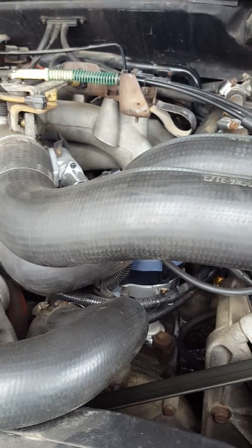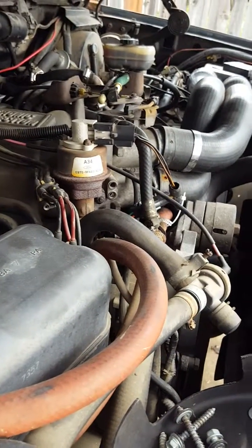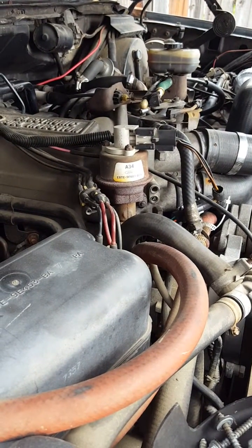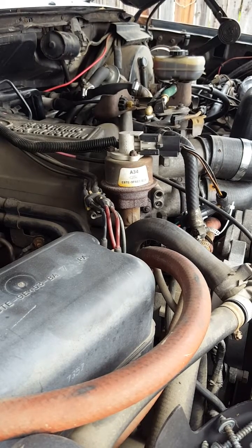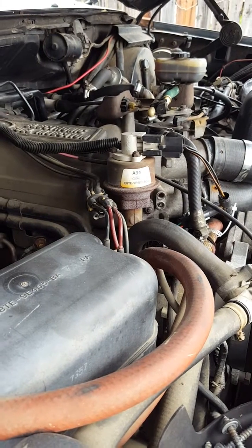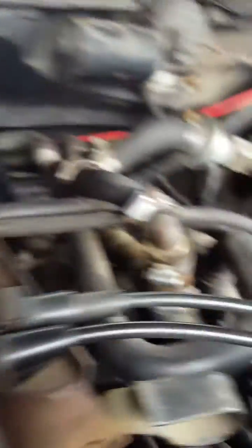That's pretty much what I've done to the 88 Ford. The EGR valve is a little pricey — about $180 at AutoZone — so I'm going to replace that. It still has a little trouble starting up in the morning. I think I need to do the throttle position sensor, but when I unplug it, the idle goes down low, and I'm not really understanding why it's not responding.